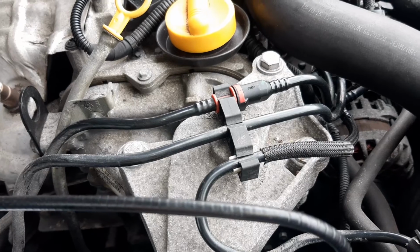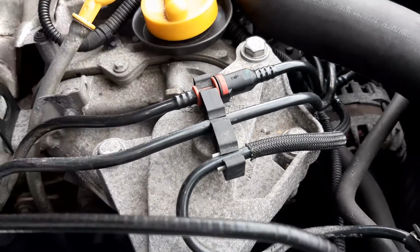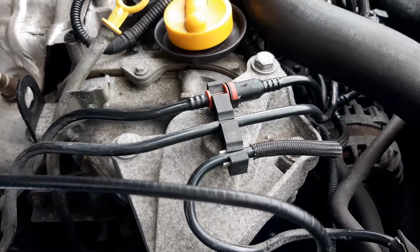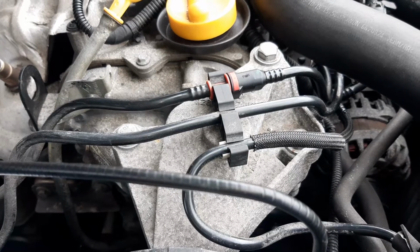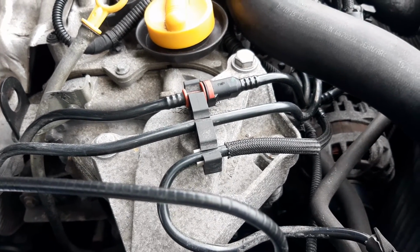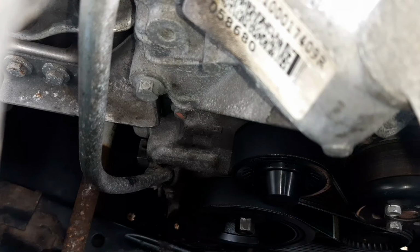In this location, located below the three pipes, you have your engine mount bracket. The engine bracket attaches this side of the transaxle to one of your engine mounts here. Inside that mount, you've got rubber that reduces vibrations going into the cabin. In this location, you can see your tube that has your dipstick. Also in this location, you can see your auxiliary belt system.